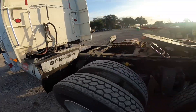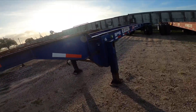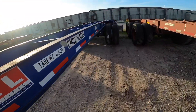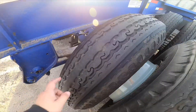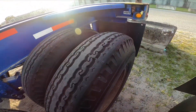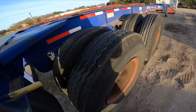See that green little slip right there — that means the chassis is good. It is a 40. Now the only thing you want to check for is the tires. Now see look at this one — it's okay, but these are chassis tires. The thing is you want steer tires, because chassis tires normally tend to blow a lot faster.